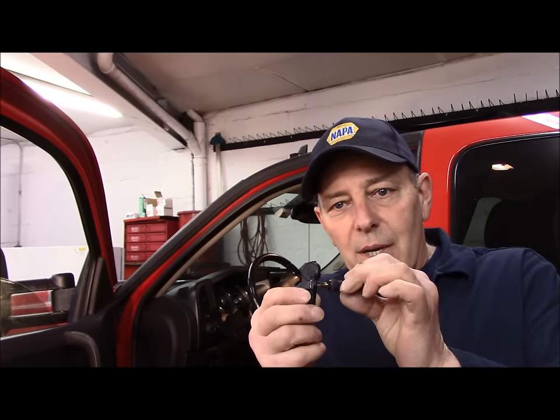In order to make sure that the tires are in the correct location, whenever I run into an issue with two failures like this, I recommend to the customer changing all four of these tire pressure sensors. It's easier changing all four of them, because these are non-serviceable — there is no way you can get to that battery inside there.